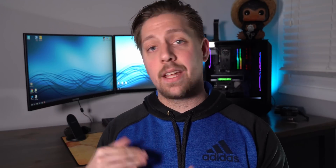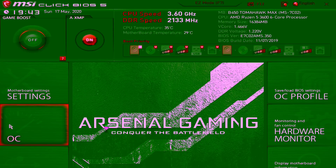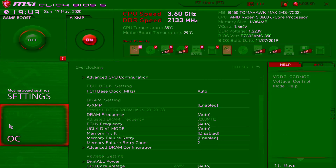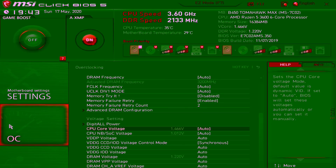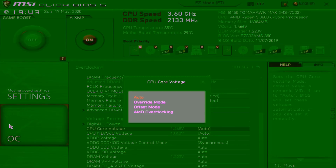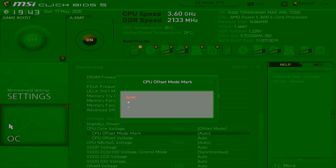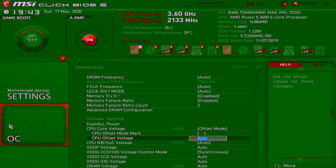For method one, get into advanced mode, then find the voltage settings. On MSI boards click the OC tab, scroll down until you see core voltage or Vcore, and switch it from auto mode to offset mode. On Gigabyte boards you'll switch to normal mode and then change the offset values. On MSI boards, two additional boxes pop up — the first determines whether you want to add or subtract voltage, the second is how much to offset by. I would suggest starting at a negative 0.05 volt offset.